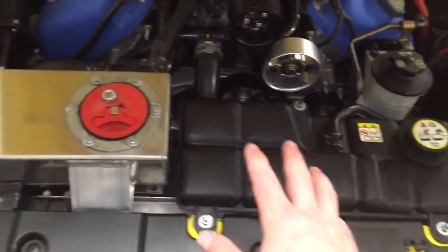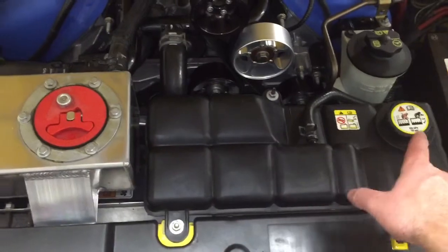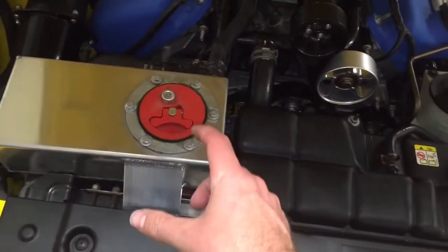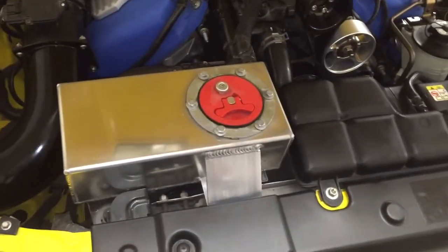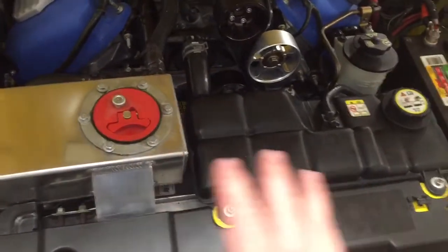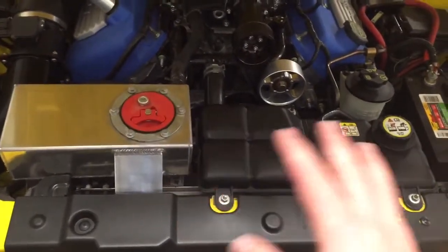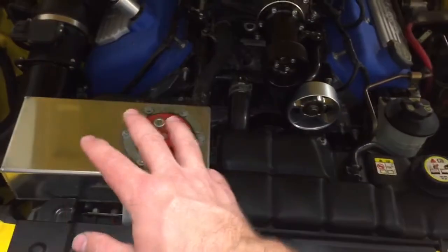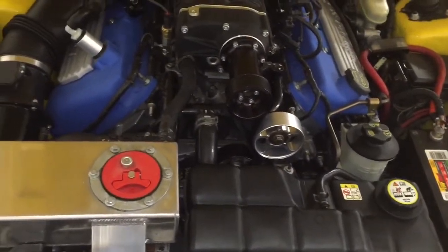On the stock Terminator there's another expansion tank right next to it. I have an aftermarket one and it looks almost identical — it has a similar cap with just a slightly lower PSI rating — and that one is for the supercharger system. The supercharger system actually has its own coolant. Both tanks run coolant, so you'd think they're connected, but they're actually two entirely separate systems: one for the engine itself, one for cooling the supercharger.